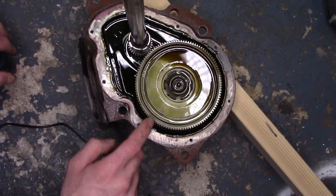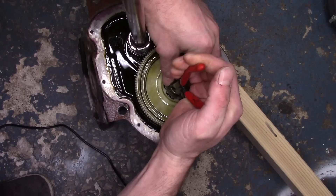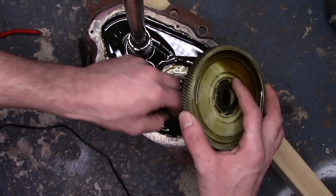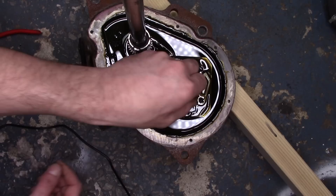The next step is to take off the plastic spin gear. For that, you'll need a pair of retaining ring pliers. Get the retaining ring out — hold it a little because sometimes these things fly right out. Set that to the side. Then we're just going to lift this straight out. You'll probably drop one of the gear pieces into the oil because it gets stuck to the bottom of the wheel. Move that piece to the side as well.